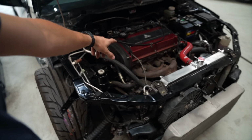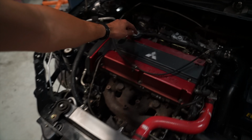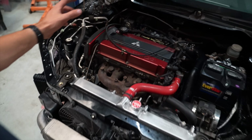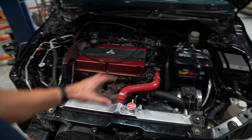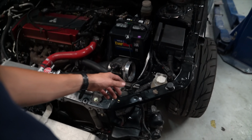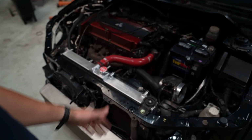I don't know if I was just doing something wrong. I'm gonna watch some YouTube videos of it and try to mess with it a little bit tomorrow because it is super, super lean. I'm probably gonna do the Tephra mod on the ECU, which is at least what I did 5 years ago when I was working on my other Evo. Basically tie the wideband into the ECU. We have some 2200cc injectors from Deatschwerks coming for this thing, and I ordered an Omni 4-bar MAP sensor for it. Then what I'll do is delete the mass airflow sensor off here and go to a speed density style tune on it for now. But as of now, it does have the mass airflow sensor on it, so it's at least getting some sort of a reading.